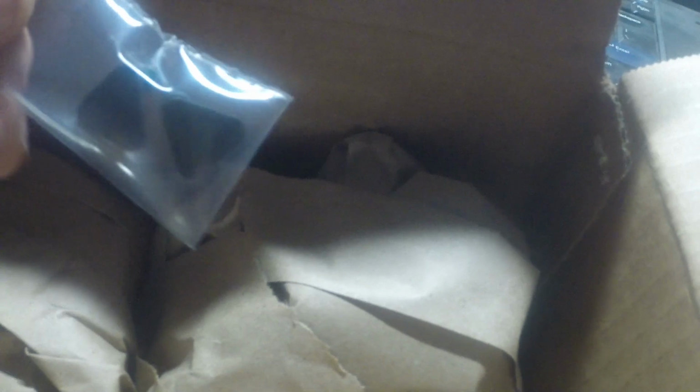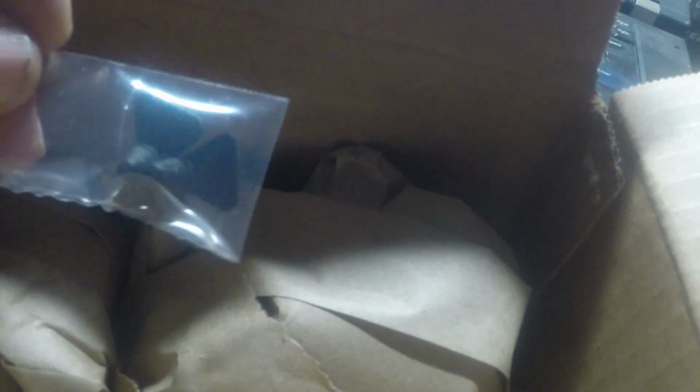We had to order a new seal for our gas cap. We made one of those, and we didn't put our vent hole in the right place. Of course, we didn't have an original one to go by, but every time we opened the fuel filler cap, we had a big pressure release, so the tank was building up pressure inside, which is no bueno.